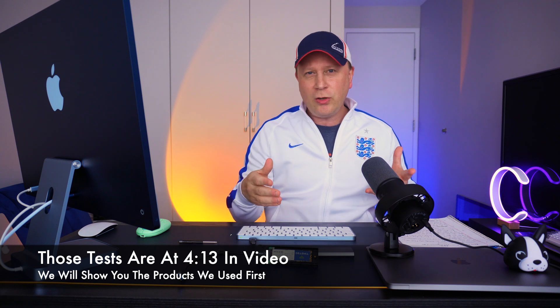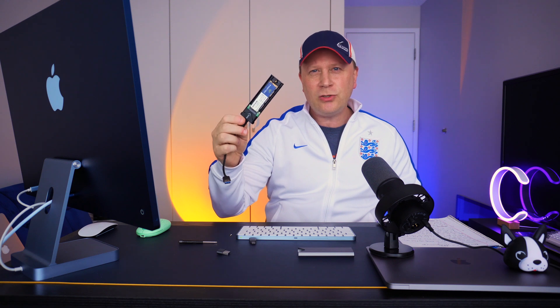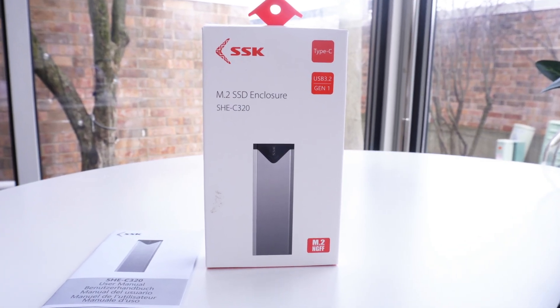What this comes down to is this is actually an M.2 SATA enclosure — it's not even NVMe — and there's a reason I chose this. Number one is so I could get the cost around 28 bucks. The SATA M.2s are a little bit cheaper right now, and so is the enclosure. But number two, SATA runs a lot cooler. If I'm using a cheap enclosure like this, I definitely want to make sure the drive's not running too hot like an NVMe drive runs. So that's another reason to use SATA.